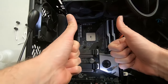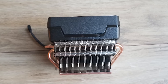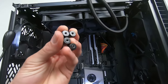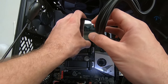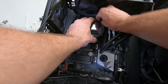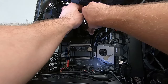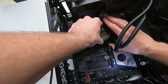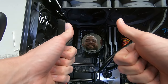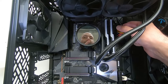If it looks anything like this you're ready to put the cooler back on. Some designs might not give you the option to place the cooler straight back on to get even mounting pressure — like the stock AMD cooler, for example; those go on a bit sideways and can end up with some uneven coverage. Otherwise, have your mounting screws handy and place it as flat as you can while applying a reasonable amount of pressure — you don't have to put all your weight into it, just enough to hold it still. Replace the screws corner to corner in a diagonal pattern: turn one until you feel some resistance, then install the opposite corner, and continue until all four screws are on. Then tighten them up individually in that same pattern until they are nice and snug. This will ensure you have even pressure between the CPU and the cooler. Be sure to plug in your fans and pump or anything else, because if you haven't, this will all be for naught.